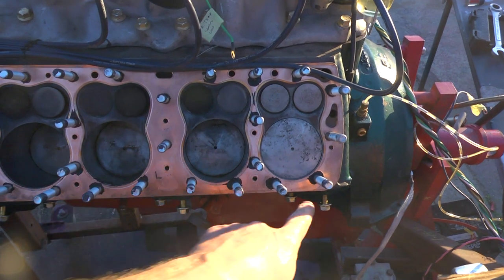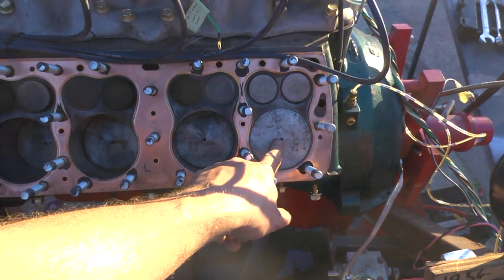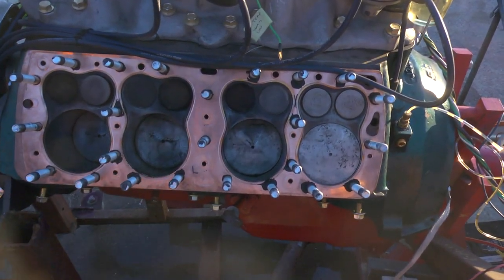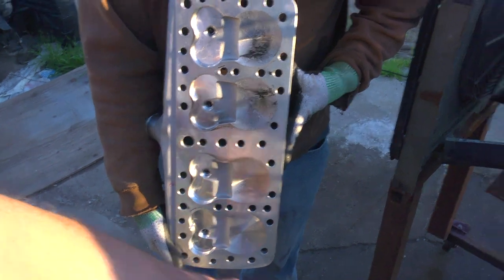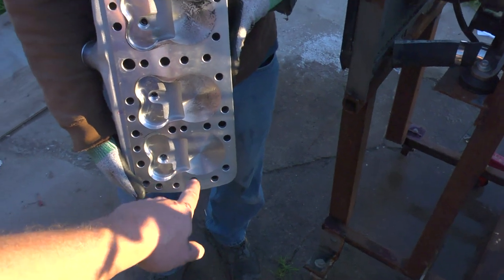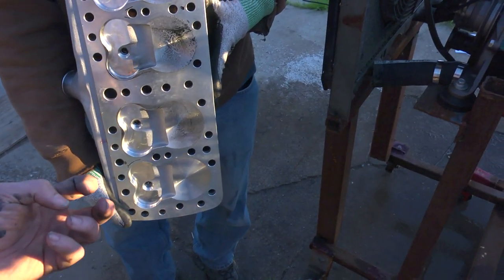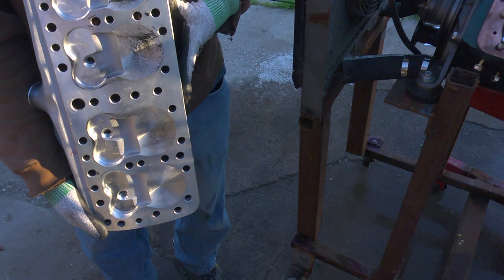While we've got it apart, we're going to go ahead and look really close on the deck and in the cylinder for any moisture. One of the things we wanted to do when pulling this apart was to make sure no water is in any of the cylinders before we call this a day. This one here you can see is clean, just like the valves and the top of the piston. What happens is water gets in there, it steam cleans - assuming not so much gets in there that it hydro locks right away. But enough is getting in there that it's flashing to steam as the combustion occurs, and it's steam cleaning it every single time.